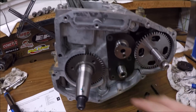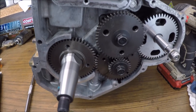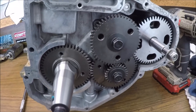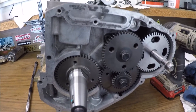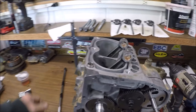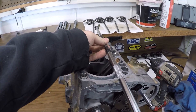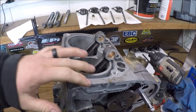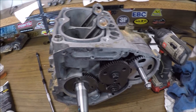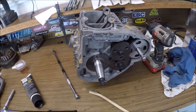Still making progress. I want to do this gear, that gear, put it all back together. These two bolts here have to be torqued to 22 foot-pounds plus or minus two foot-pounds. I don't have the holder for it, so I took an extension, put some tape around the two spots where it would meet the crank or connecting rods, put it through there, and put a towel on each end to protect the surface. 22 foot-pounds isn't that much, so it was just enough to hold it. Got those two torqued now — everything's fine, nothing scratched, nothing gouged.